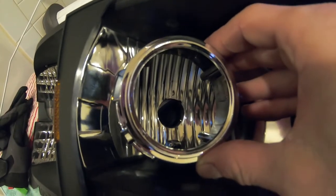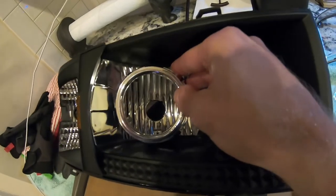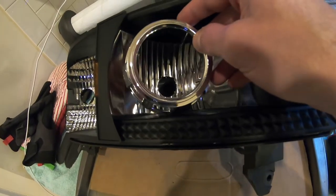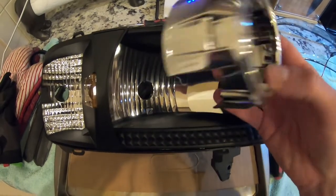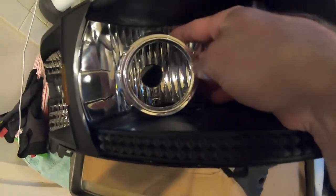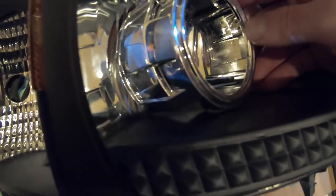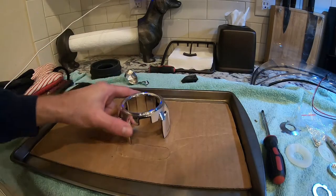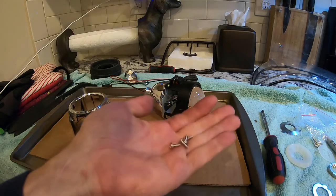I made some marks here and the center line isn't lining up with the hole in the back of the headlight housing. So we just need this shroud to sit a little bit lower on the bottom of the headlight housing - we're going to trim a little bit of this off. The shroud is now cut - I just followed the lines that are already built into it using a little hacksaw blade. It'll fit down in there a lot more concentrically to the hole in the back of the headlight. Once everything's installed, you really won't even be able to tell where you made the cut. Now we can attach the shroud to the projector using some of these small Phillips head screws that come with the kit.